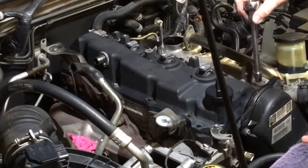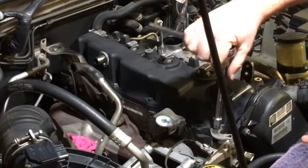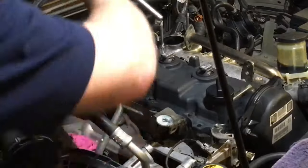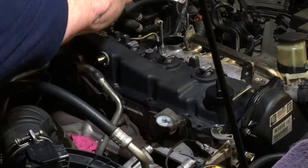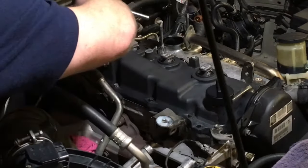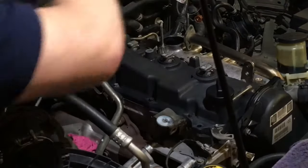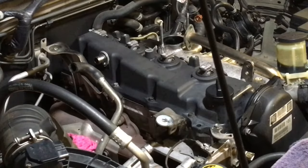We're going to torque these up to 9 newton meters eventually, right? Because that's what the torque setting is, and we've got the torque wrench out, so that's what we're going to do. It's not hard to do. Now, some people in the trade aren't used to using torque wrenches. They're going to think, geez, why would you do that? I'll tell you why, like I said. We got it out, and then we're just perfect, right? There's no maybes. It just doesn't take long to do.